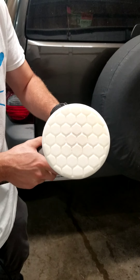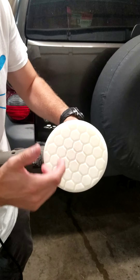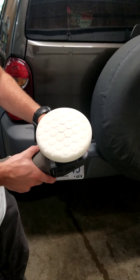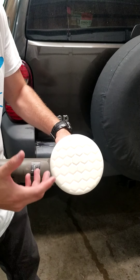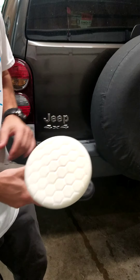Now this one's not too terribly bad, but if you look really closely you can see that there's some browning in this pad, and this is just from this one little section. Now if we use a more aggressive compound that would get further into the clear coat, we would get even more. In fact, I've seen some of these orange pads turn pretty much black just doing one section.